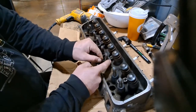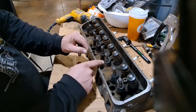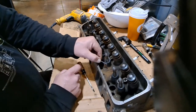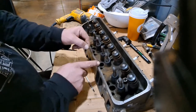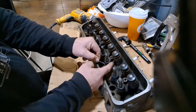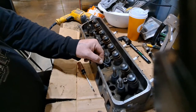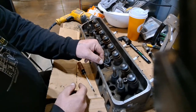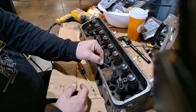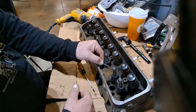You know, I may do it going this direction, even, whatever. I'm going to make sure they're down far enough also, because if these try to pull out, I don't want it to break my head right here. So I do it at an angle down. Also, the drill angle to miss this helps out too. If I do that, it gives me more meat on the back side, less chance of this side breaking. I think it's a lot less work than putting in the screw-in studs, and I think it's probably just as efficient.